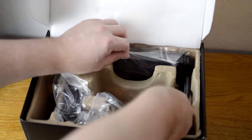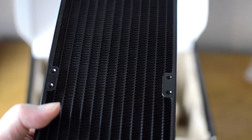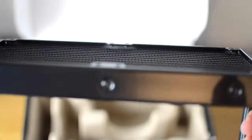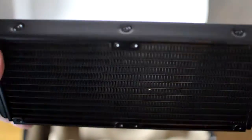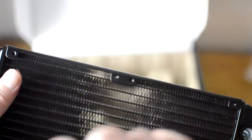And finally the main part of this kit is the water block and pump, which is attached to the radiator by these two industry standard pieces of tubing. These cannot be detached as this is a closed loop liquid cooling solution. Effectively how this works is that water is forced around the loop by the pump, up through one of the tubing pipes to the radiator where, combined with the fans, it will dissipate the heat stored within, and then the cooled water will return back to the pump via the other tube to begin the cycle once again.